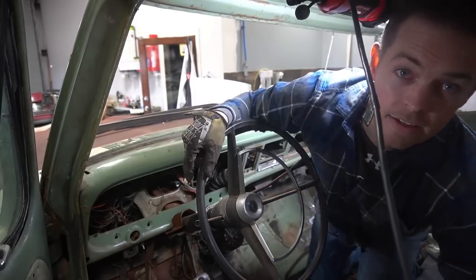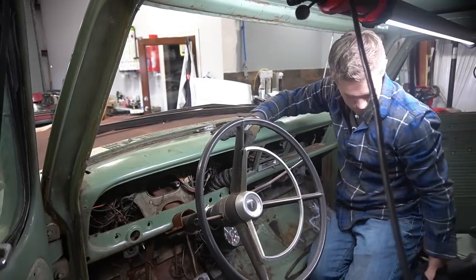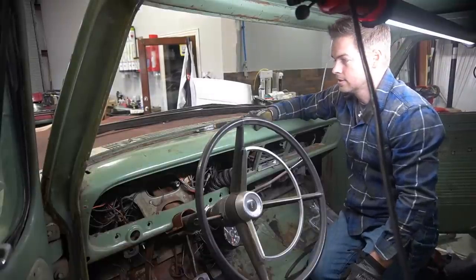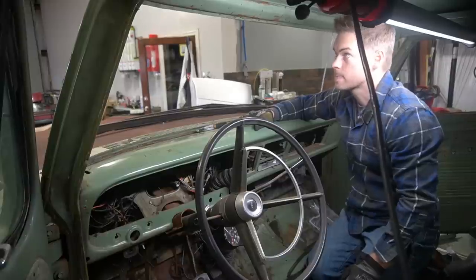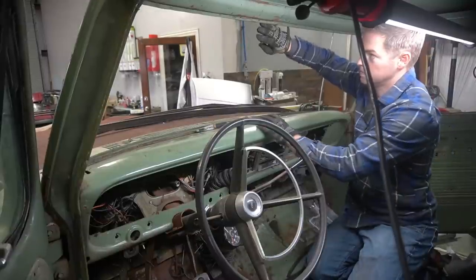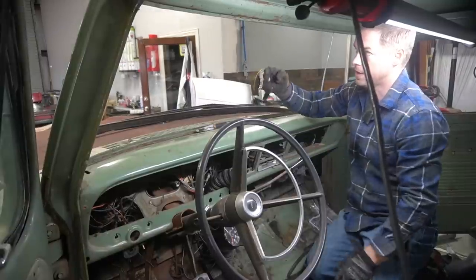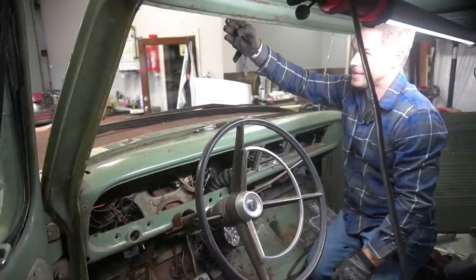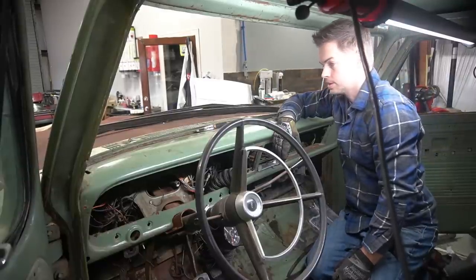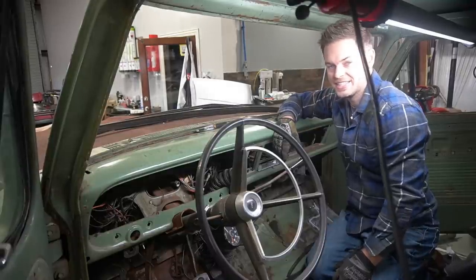It's out. Total of 9 minutes from when I started cutting on it a second ago to taking it off, dropping pieces on the hood, and actually setting it on the ground out there. All I did was cut the seal along this pinch weld, I guess where the seal kind of flips up under the pinch weld. I just essentially cut that in half all the way around and then ran the blade between the glass and the seal in case there's any sort of glue or urethane on there. It seemed to cut it off and come out just fine, so hopefully it goes back in just as easy, but I kind of doubt that.